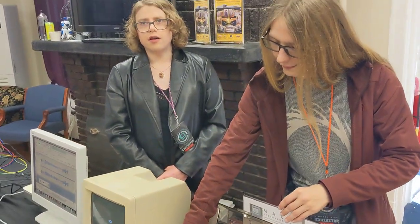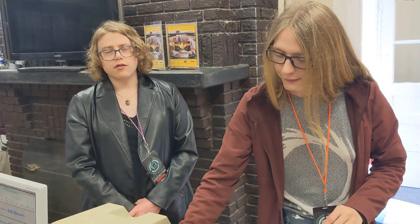The disk has a variable write speed where the edge of the disk moves slower than the inside of the disk, allowing you to get that extra storage. The problem is that a Mac Plus disk cannot be read by a DOS machine. It cannot be read by late Mac machines. If you took a USB floppy drive and plugged it into a modern Macintosh, it would not be able to read and write those disks.